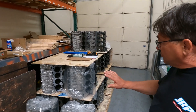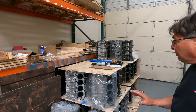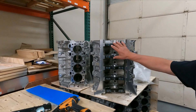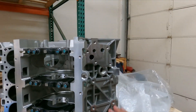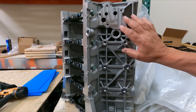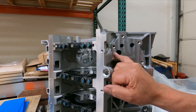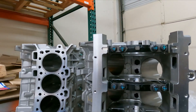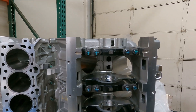Same material, same hardness, same ductile iron sleeve. However, because it's a production replacement, it's going to use the production-style mains, the production bolts or studs — with an oil filter mount, so a factory Ford oil filter mount. You may notice it has a third hole, which only became standard on 2015 and later coyotes. This is an oil drain hole back to the crankcase. Earlier coyotes only used two holes for oil in and oil out of the filter.